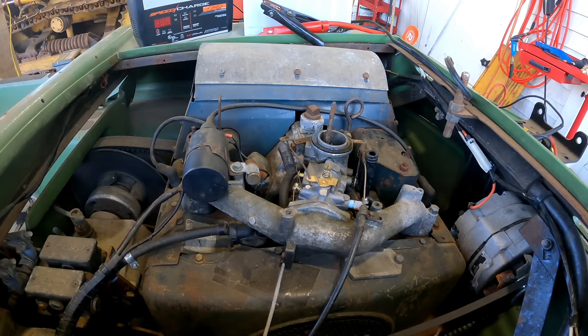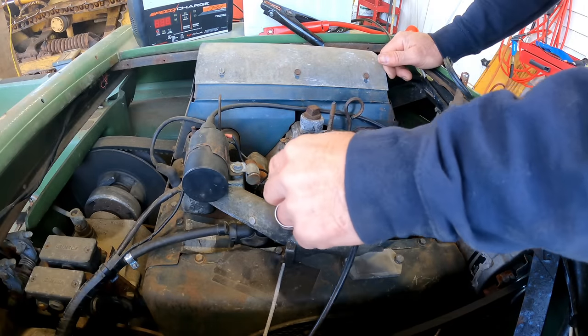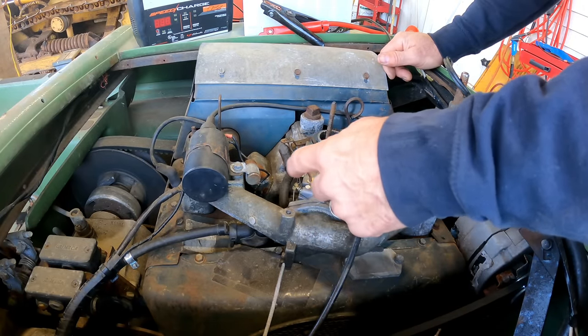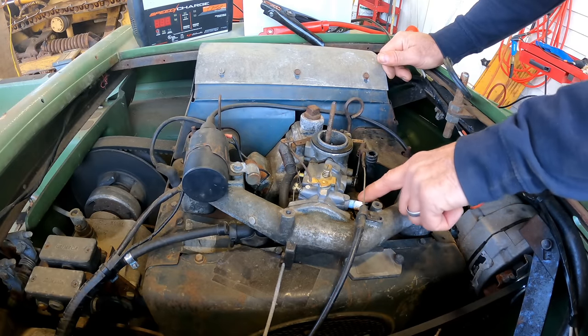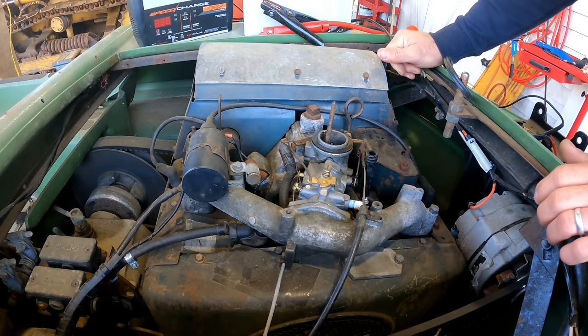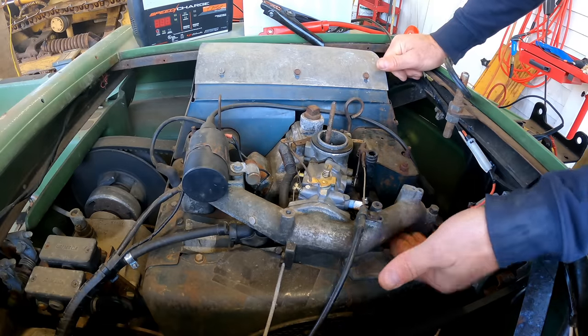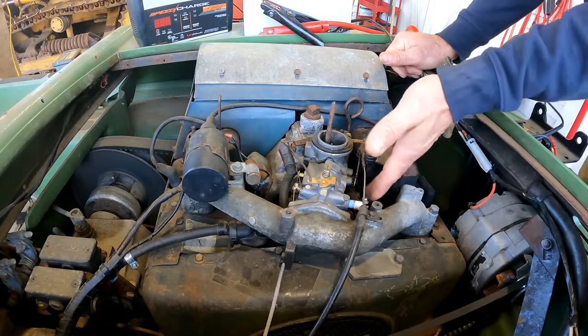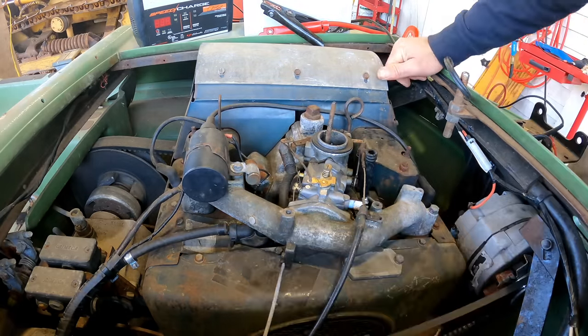Yeah, I think I'm going to pull this carburetor. I think it's worth taking it off. It's going to be a fair amount of work. Hopefully not for nothing. But I don't like the way these are, it doesn't seem to be clean. And I highly suspect that there's a bowl full of that junky fluid in there. Be worth getting that out. The way this thing's positioned, I can't even get to the bowl. I can touch it. Yeah, I think we pull the carb.